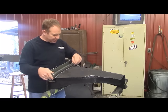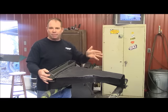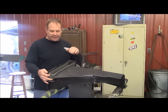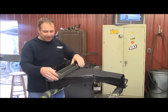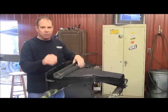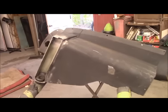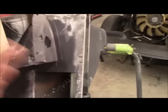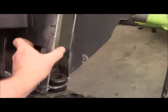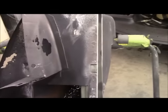You can see how nicely that's going to fit in there. I cut this where I could fold a lip back and another lip here so I could secure it real nice. Now that it sits down in here, that's going to put this directly in the center of the frame rail, giving me more room for my air conditioner lines, coolant lines, and everything in the middle. It would have made everything way too tight the other way, but this will be stronger, better, and have more clearance. You can see how I've got that inserted in there - I weld all the way around, inside too - that's extremely strong.